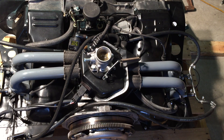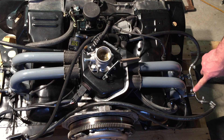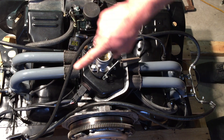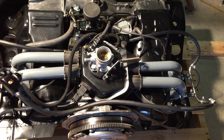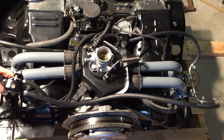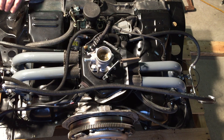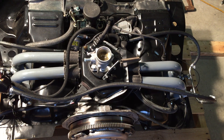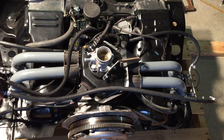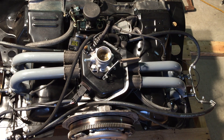On the motor itself, we've got the fuel lines here. There's a splice connection here for shipping. The supply side goes into the rail — that's the pressure from the pump all the way around. The long hose at the back is the return, and that goes back to the tank. Your fuel pressure regulator is here. It's pre-adjusted to three bar and has a vacuum port to the manifold to lower the fuel pressure at idle. When you test fuel pressure, disconnect the vacuum port or do it with the engine not running. There's also a pressure gauge port here if you wish to add that. I usually screw these to the rear engine tin to secure it.